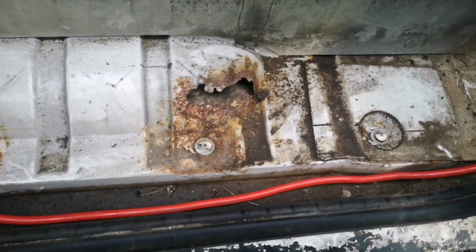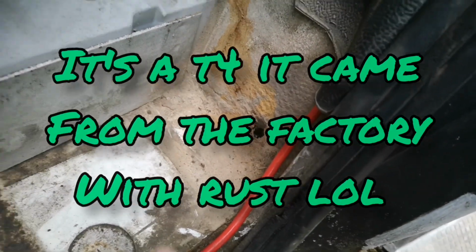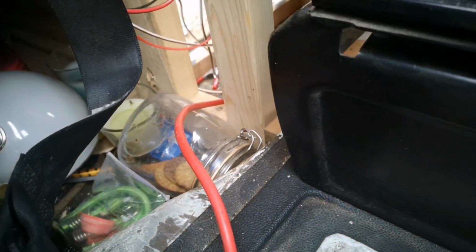So the cable is through the bulkhead, round behind the fuse box, comes down over the top of the wheel arch, and then ignore this, this is the next project. Oh, and this is another project. The cable then runs through the channel up and into where the battery will be.